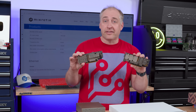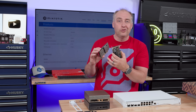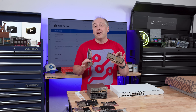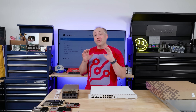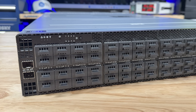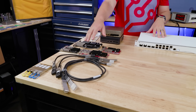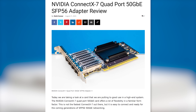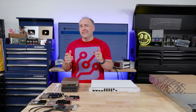QSFP56DD and QSFP112 aren't the only 400 gig standards. In my hands here I have two ConnectX-7 NICs — one is an OSFP NIC with a single 400 gig OSFP port, and one has two QSFP ports you can combine into 400 gig. If you want to go from an OSFP 400 gig port to a QSFP56DD port you need the right optics, which can be completely painful. OSFP is super popular in AI servers — NVIDIA uses them heavily. We have a large 800 gig switch with 64 ports of 800 gig OSFP. We also have an assortment of NICs from Broadcom and NVIDIA here, and we recently showed a ConnectX-7 with four SFP56 ports that would connect to these SFP56 ports on the switch.